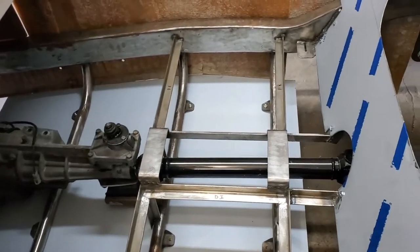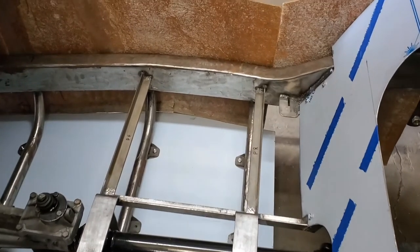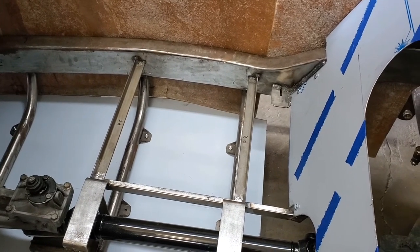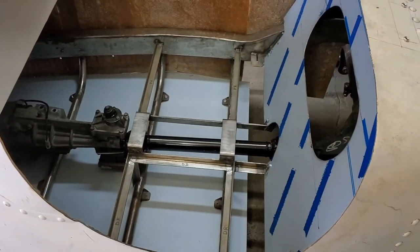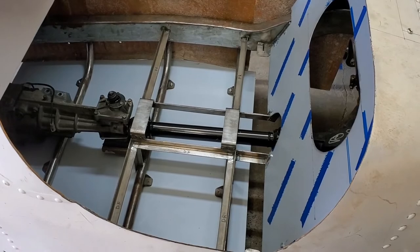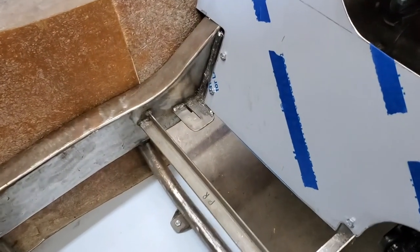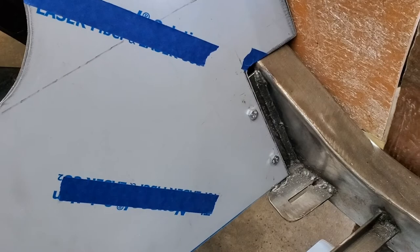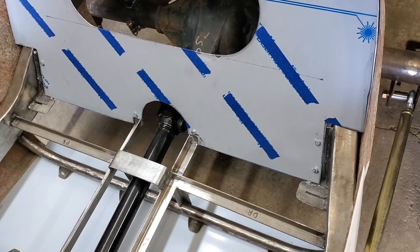With the floor trimmed out, you can see how much room there is under the seats for storage. Still haven't figured out what kind of box or basket I'm going to use, but it's going to be pretty good sized. At the rear of the pan, I left a few inches sticking out past the back cross member — an inch or so beyond the rear of the scuttle — so I'll have a flap to attach a rear section of belly pan that'll enclose the underside of the boat tail. I also welded in a couple of seat mounting brackets at the base of the rear bulkhead on the passenger's and driver's side. The seat back will rest on the bracket with a tab that slots down through it and holds the lower seat back into position.